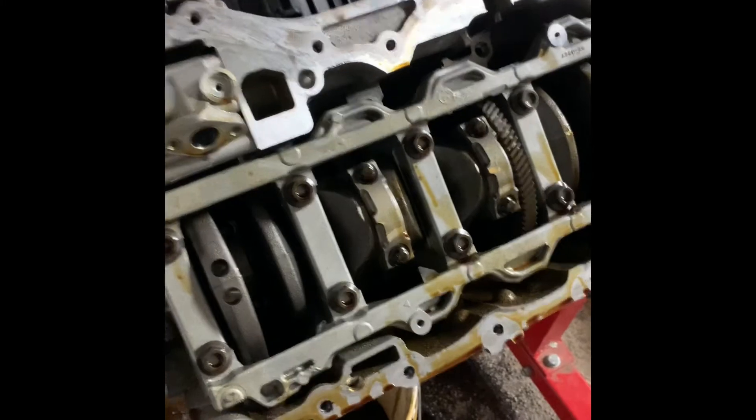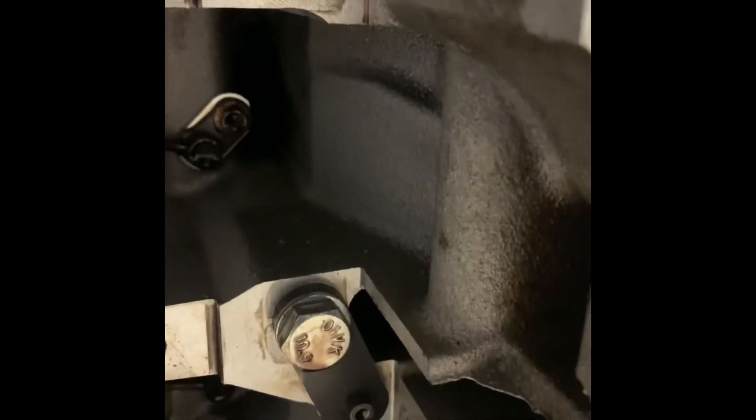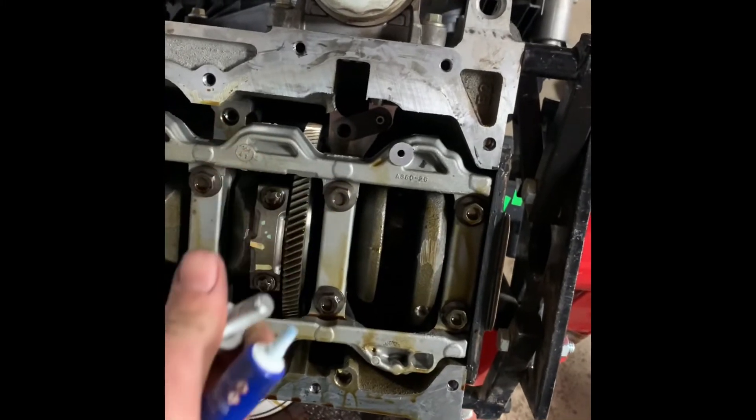This little pan looked pretty good — there's no chunks of metal or anything in it. This engine's only got 14,000 miles on it. Took the balancer shaft off, and on the old 2.3 block it's got a balancer shaft delete plate that just blocks off the oil passage, so I'll take that off and put it on the 2.5 block. Now I just have to put this bolt down in the hole to get that block-off plate secured.